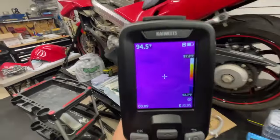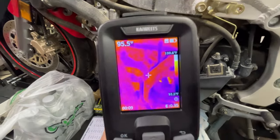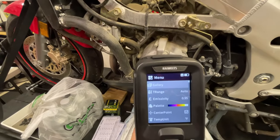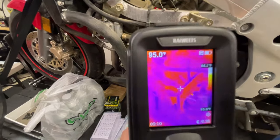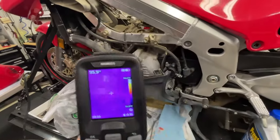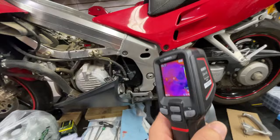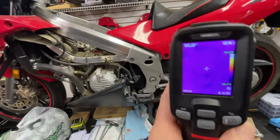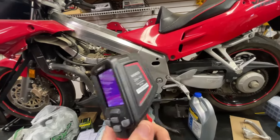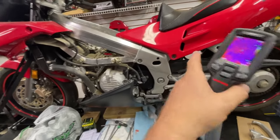Check out what you can do - let's say I'm taking a photo of this. I'll pull the trigger - 96 degrees. Let's take a photo of that. How cool would it be to check charging systems, regulator rectifiers - find out what's nominal. You could start doing temperature readings when everything's normal and have a baseline, a birth certificate if you will, on what things look like so you have something to compare against when diagnosing.